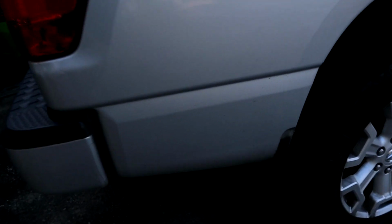This is one of the smaller diesels on the market. It's a 5.0 liter Cummins, and it doesn't put out a whole lot of power. And so it doesn't really need a 5-inch exhaust. A 4-inch exhaust is plenty for this truck. And also I save a lot of money doing that. To get a full 5-inch exhaust for this would be $800 because they don't make a lot of them. And I don't have a tip for it yet.